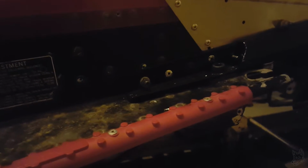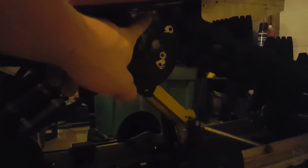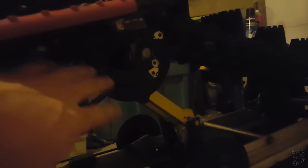So I've got it all mounted to the rear. Everything kind of holds on to the rear of the original tunnel, the main chassis, and also the rear skid mount, which is dark, but it's right here, and goes back to our new rear skid mount, which I used some Procline parts. They're not exactly meant for this, but they fit really well, and you can't really see, but in here, that's all reinforced.